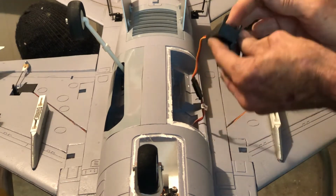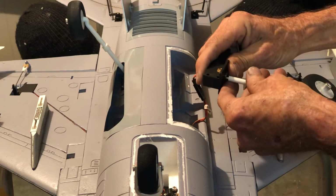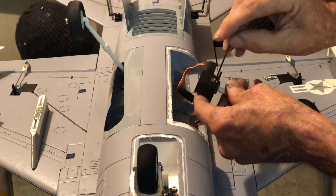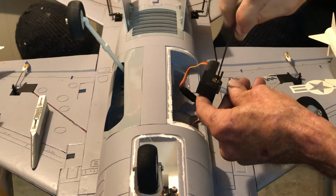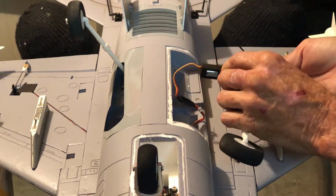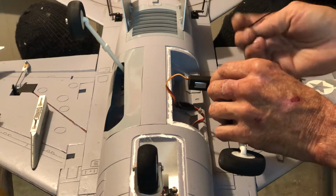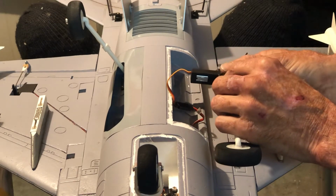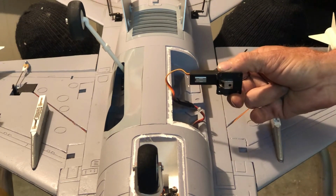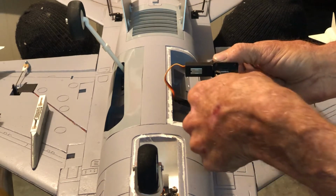So we've got to get that one. I don't want to turn that wheel. I do want it to come out. Loosen up this a little bit more. Try not to get it to go all the way out. You don't want the thing to fall out. But you just want it up there enough where that axle should slide out. And there it comes. My flat spot's on the top here. Make sure I'm putting the right strut in, and the flat spot on the top, let's see.